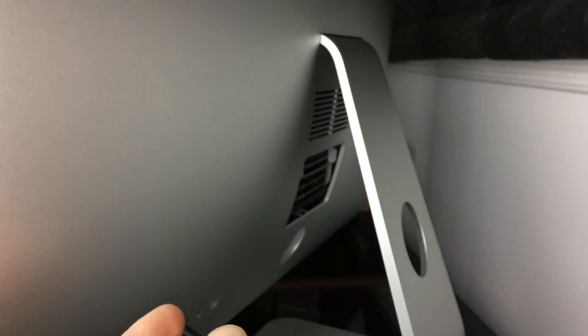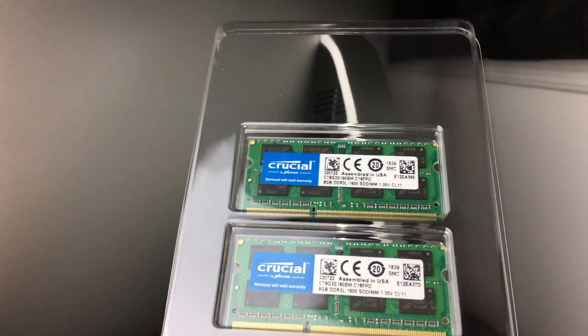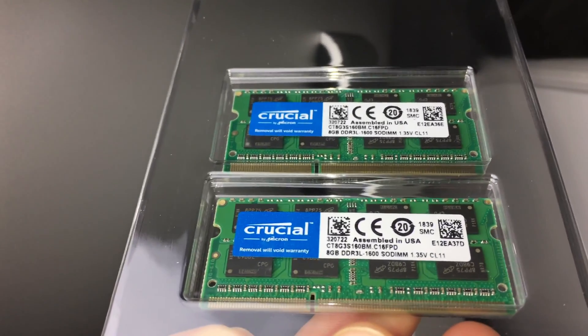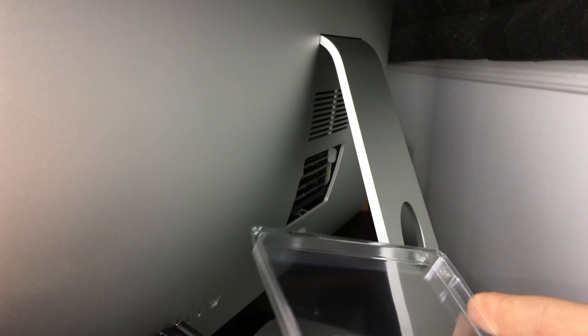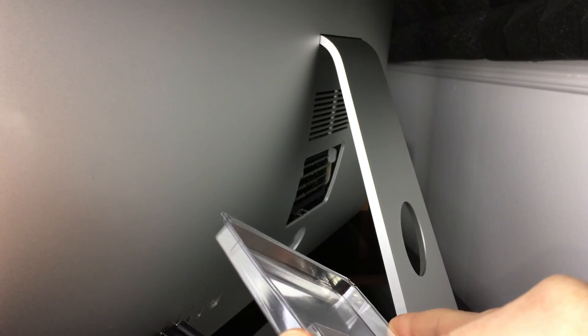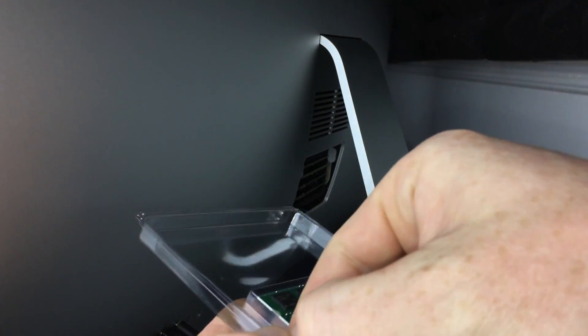This is a brand new RAM. Again, touch some wood before you guys touch the actual RAM — the brand new RAM and the old RAM, same deal. Touch some wood, don't have any static on your hands. Make sure your computer has been off for at least 10 minutes before you proceed with anything, even before taking that part off — you guys should have waited.